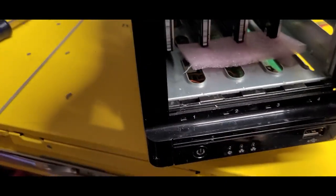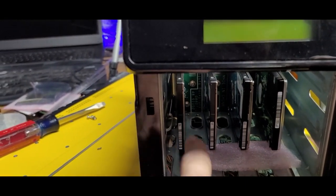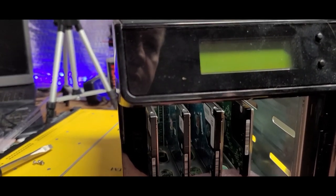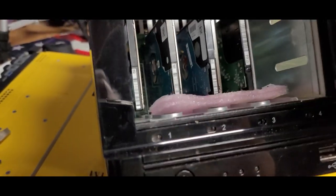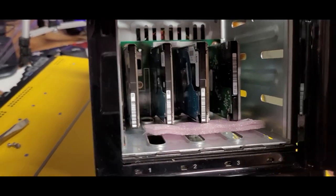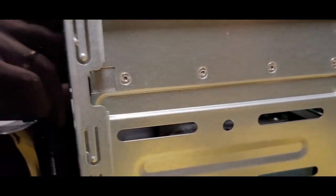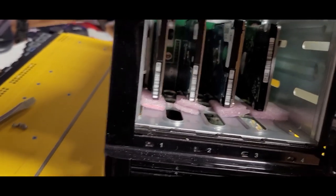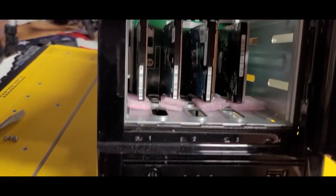For now I'm using anti-static padding. As you look here, this one right here tends to vibrate a little bit and that's not good, so I'll have to fix that. My thought is this air ventilation process is actually going to work pretty good for these smaller drives, and give us what we're looking for to accomplish our mission statement — and that is how to repurpose this useless NAS array because its caddy is no longer servicing correctly. Obviously vibrations, cavitations, and so on caused by spinning hard disks can cause some additional problems. What I did this time is I'm putting foam supports, because foam is actually very good at stabilizing hard drives, especially when you're doing testing.